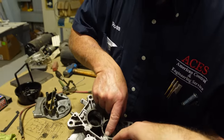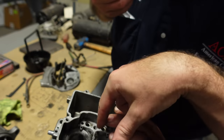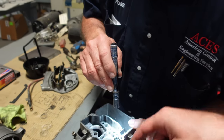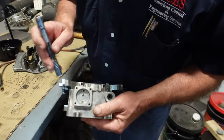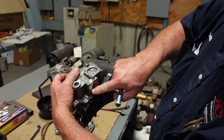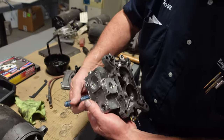They're probably not. Now see, there's the slots. I did spray through whatever. The slots feed out of the bowl or whatever right there. Yeah, so I did blow solvent through those and they're great. Okay, well you probably got it all clean. The only one I haven't checked is that pumper on the side. Isn't that the accelerator? Right. Well you can see light through them. Down there, them two back here at the back. Look great. Those two guys. All right. This is your vacuum control for extra fuel.